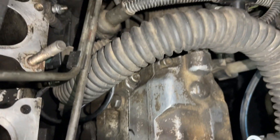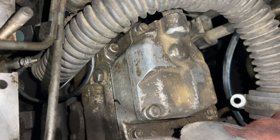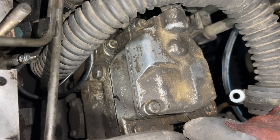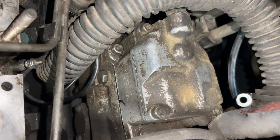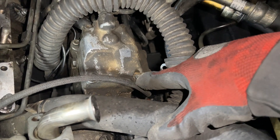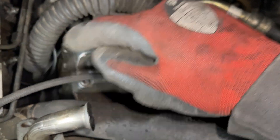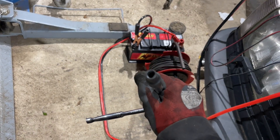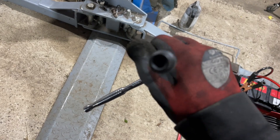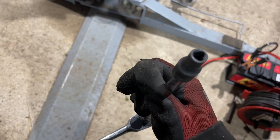I've read that the idling is affected by pump position too, so as long as we get it back to about 750–800 RPM when running, hopefully we'll be all right. First job is to pop this top cap off — we've got to undo this special bolt with the special Bosch socket. I'll put a link to where I got them. It's a triangle shape and it goes all the way through — top section, middle section, into the bottom section.